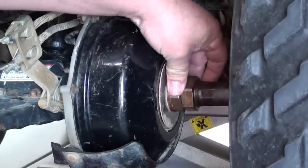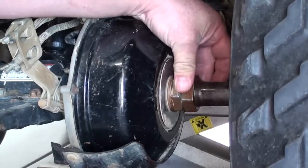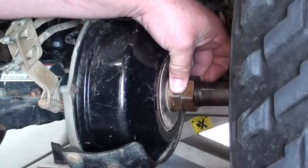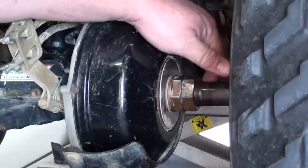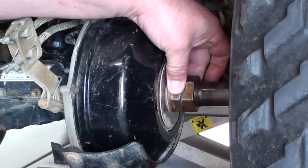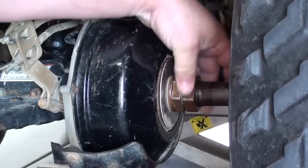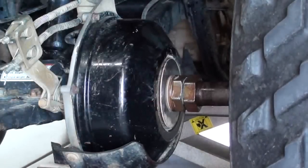The first thing you're going to want to do before you even take the wheels off is get in here and loosen off these axle retaining nuts on both sides of the axle. It's a lot easier to do it while you've still got the wheels in place, because a lot of times these are rusted in place and they can be a real booger bear to get out. Take plenty of penetrating spray, spray up in the threads real good. If there's any mud, corrosion, or rust in there, hit it a lick or two with a wire brush before you get started. Then just get a big crescent wrench and have at it - get those broke loose to where they'll turn freely on both sides.